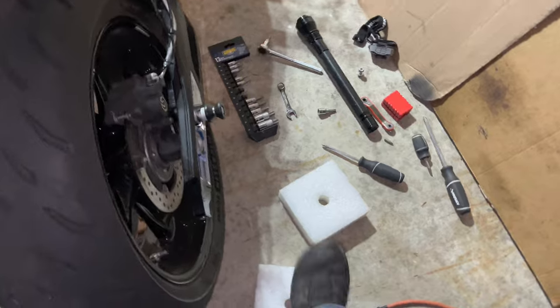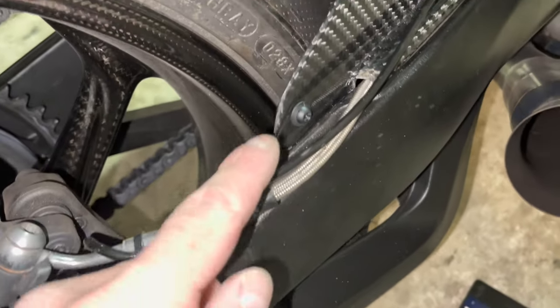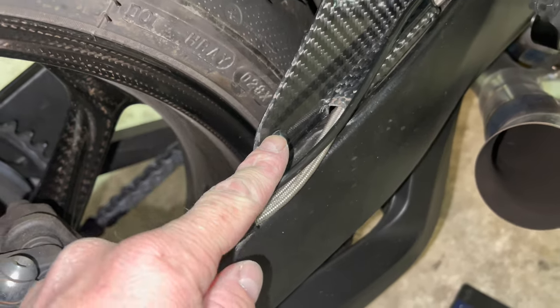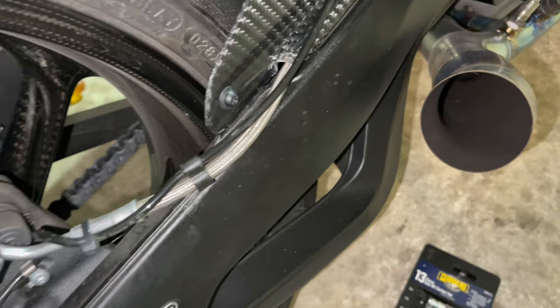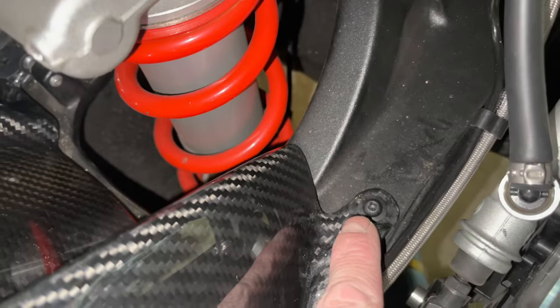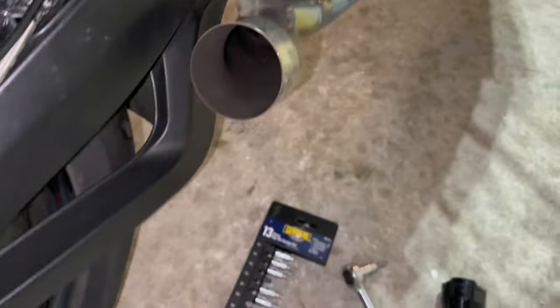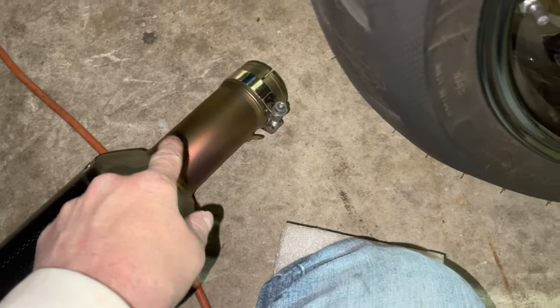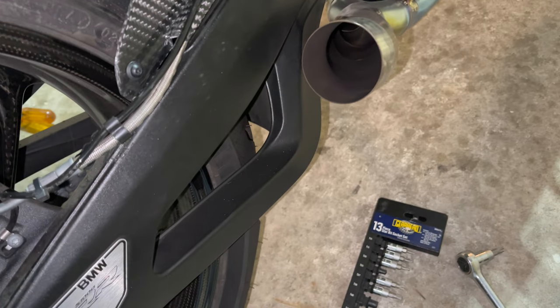After that's all set — I did end up taking off the muffler just so it would be a lot easier to get this back in. I was able to get it out without removing the muffler, but putting it back in — forget it, I wasn't able to do it. So put this screw back in and then put this screw back in as well. Be careful because these things strip. When I go to put the muffler back on I'm going to put some WD-40, clean it up, and then it should slip on pretty easy.